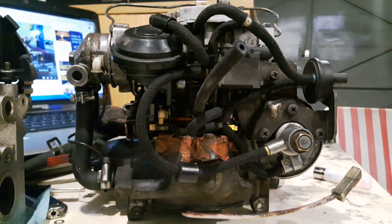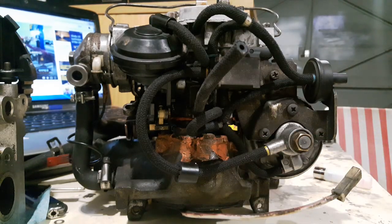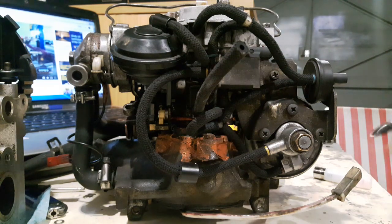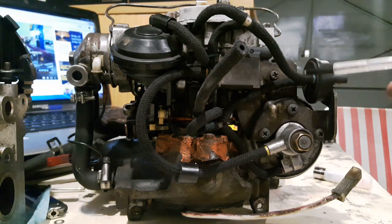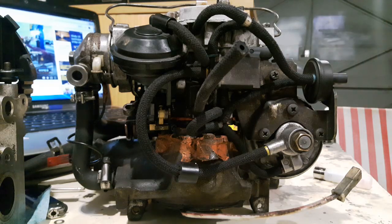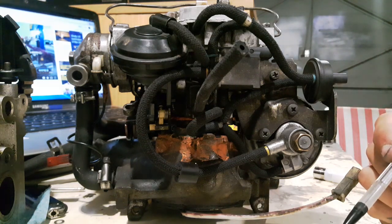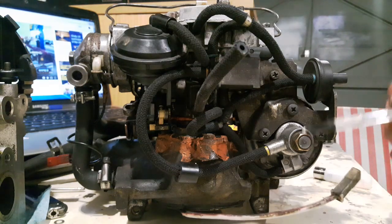The quickest and easiest thing I can say when it comes to redoing all your vacuum hoses — and this is assuming you have no hoses on the carb, because sometimes Pierbergs come through having already been faffed about with, or the rubber pipes have cracked and broken off. When more than three or four have gone, it can be hard to tell where they all went. So I recommend starting at the bottom of the carb and working your way up to the top. The reason being the top port is a fresh air port, and the bottom port is where the process begins.